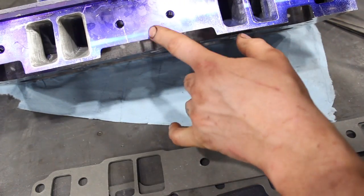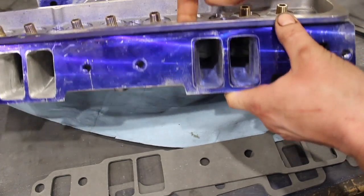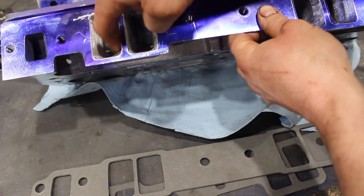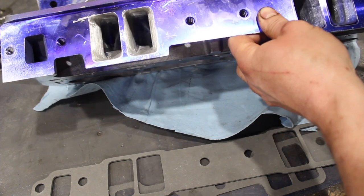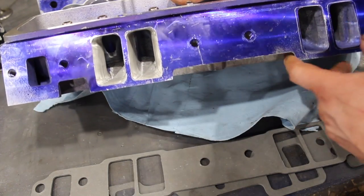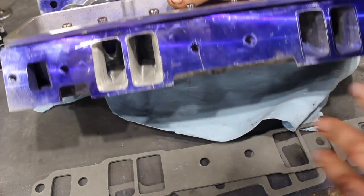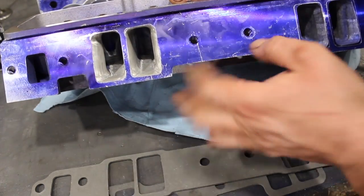Just be warned if you're going to do that: the pushrod pinch point here — where you see it bumps out, this is where the pushrod comes down through the head — there's not a lot of material there, so I didn't really open it up much. I just blended it in. I didn't take much material off there. On the inside you can take a little bit more off toward the center divider, but be careful not to take too much off at the pushrod pinch point because you can very easily blow through. These heads probably wouldn't weld up too nicely, and if you have to send them out to get welded, it kind of defeats the purpose. So all I'm really doing is gasket matching to a 1206 and just blending and smoothing it out.